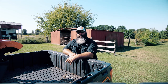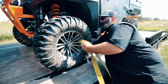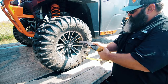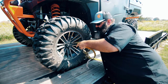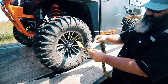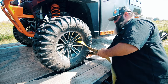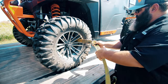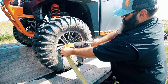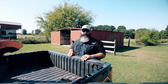Next, showing you the technique we use. I'm not saying how we tie down the machine is the best and only way — this is only my opinion and how we do it. We start by running the strap through the tire with the non-metal ring side of the strap. Put the metal ring on the sidewall of the tire and loop the other end of the strap through the metal ring, pulling it towards the middle of the machine. Make sure the strap is not pressing against the valve stem and move the black strap cover to be centered where the metal ring will meet the pullback point. The black strap cover gives extra protection against wind wear on the strap against the metal ring.